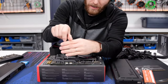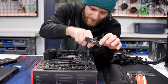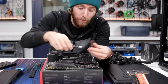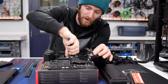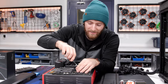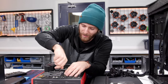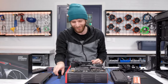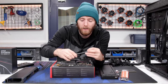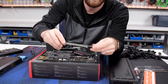And then the one that I actually have anything installed on is this Crucial P2, a 2 terabyte drive. I'm gonna just chuck this down in the bottom slot. This is the one I'll actually be booting off of. There's just no point putting it in the primary slot because this is a Gen 3 drive. It's Colin's test bench drive. So for these live streams, we're not even trying to maintain the facade that this is a computer I'm building that will stay built forever. It will be taken apart at some point later. Probably today, yeah. But still, while we're running it, we wanna do a good job of keeping it cool, right? There we go.